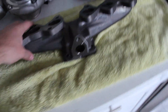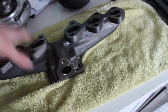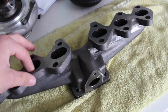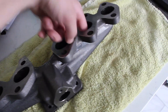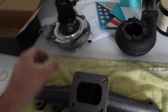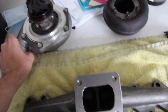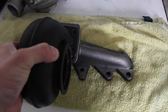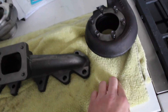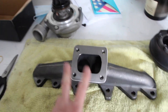These manifolds are rated up to 600 horsepower, but I'm only gonna make around 350 to 450. Initial thoughts — looks very good. I thought I'd have to get a Dremel to clean out the holes, but everything's in really good shape. This is a T4 flange. My turbo is a Garrett GT3582R, and I have it taken apart because the hot side is a T3, so it won't fit. This exhaust housing is a 1.06 — huge, drag-style.